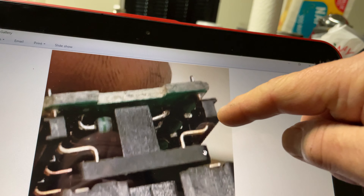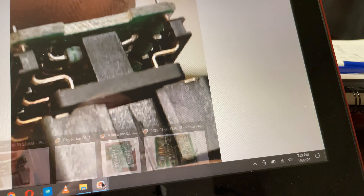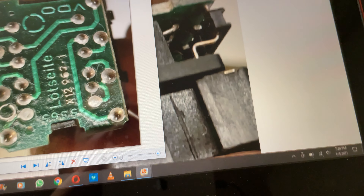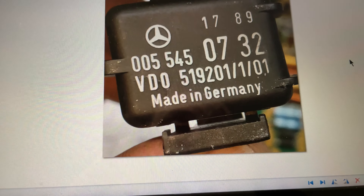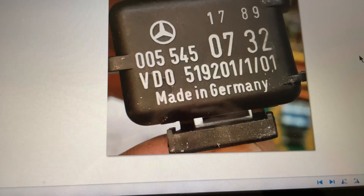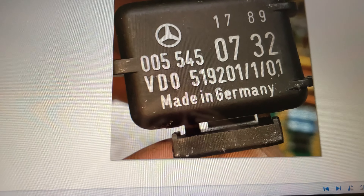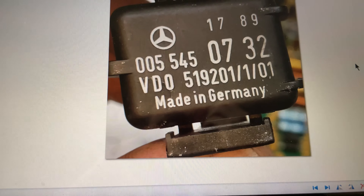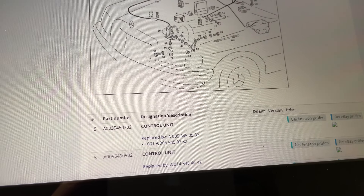Let me orient the paper correctly so they match up. The resistor values side by side are: 3.3 kilohm, 0.1 ohm, 27 kilohm, 1.5 kilohm, and 500 kilohm — and the last pin position is empty. That's how you can test this plug.